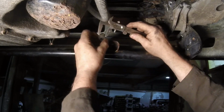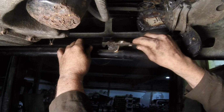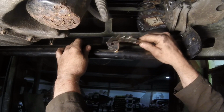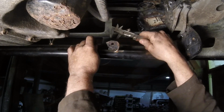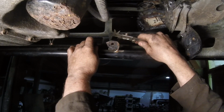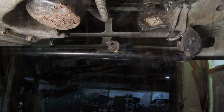What I got to do is, this thing is like that, so I got to make that hole that big. So I just have to hog it out. That's it. So don't do what I did. Rush. Get this thing all squared away first with the grommet, then put it in and mount the intercooler. That's what happens when you rush. So, all right, let's pull this thing down so we can start finishing up the top of the fender so we can put the headlamps in and finish up the episode.